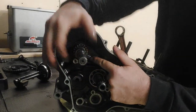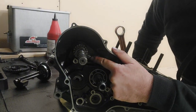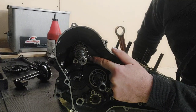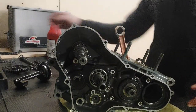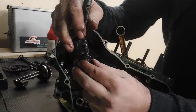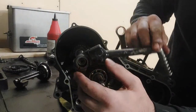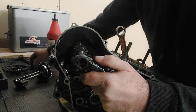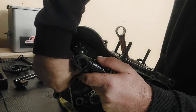So you'll see there's a spot in the case, sorry my lighting's horrible, that your spring sets on, and there might even be a little bit of a rub mark through the paint from that spring riding back and forth. Get that started. And then you can get the kick-start just a little bit and rotate it down. And then this capture plate should be able to go right on. There's 2 bolts that hold that in.